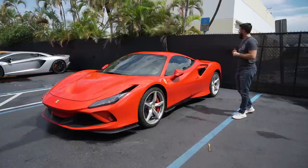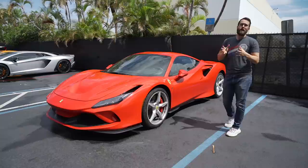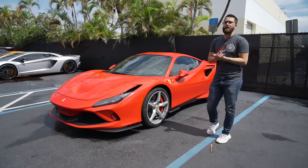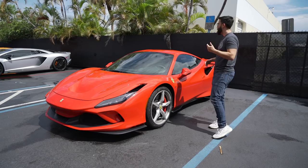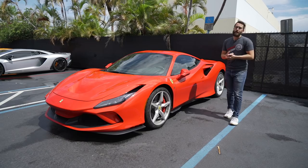That's going to be really cool. Suspension-wise, we're going to go back to Novatech with their sports suspension — it's going to drop the car, reduce some of the body roll, and make turn-in and turn-out a little bit tighter. And then we'll also finish it off with the Novatech full exhaust. I'm not certain if it's going to have the flap regulation, which is basically the valves — some customers like to have it loud all the time and others like the ability to quiet it down in traffic or getting into the neighborhood late.